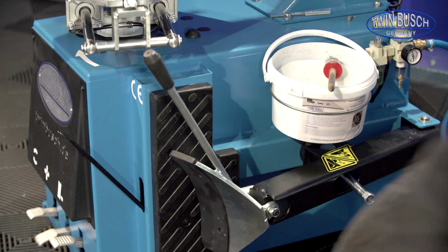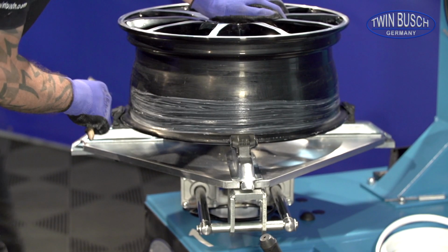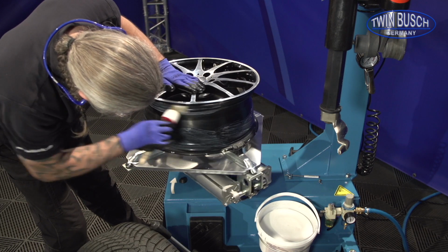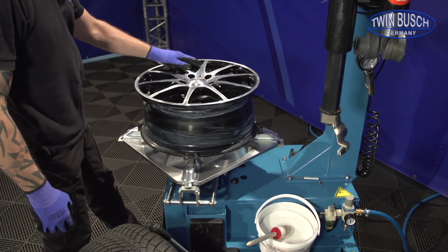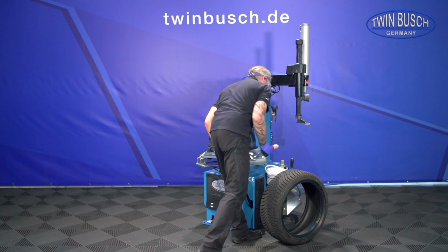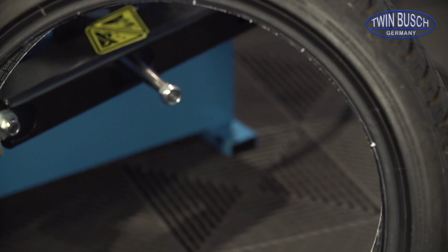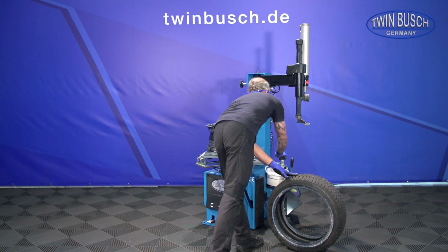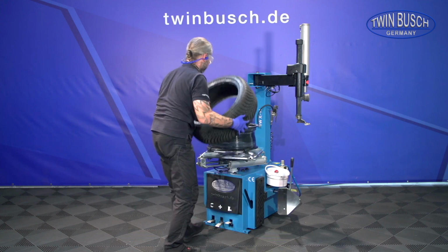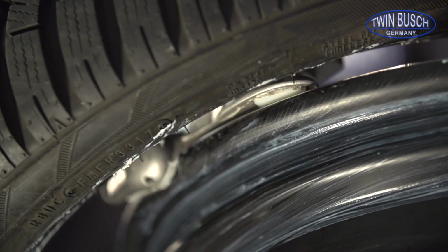We will now perform the reversed process, mounting the tire on the rim. The mounting paste is particularly important for mounting tires. If the tire bead is not greased carefully, it will not be able to slide easily over the mounting head and the flange, and into the rim well. With a correct placement and a short turn, the first bead is back on the rim.